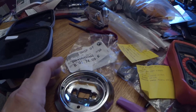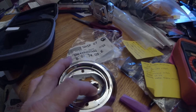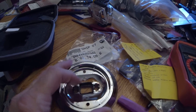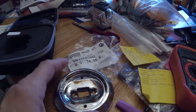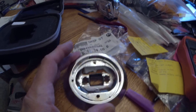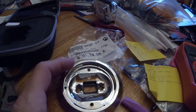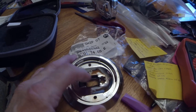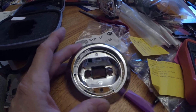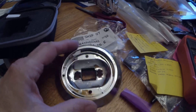On the factory one, around where the electrical contacts go, there's a blue plastic insert. The reason is the vacuum-deposited chrome — like you see on this one — is conductive. So as soon as I put the contacts through here, there's going to be a direct short and it's going to be popping the fuse for the overhead lights and the accessories in the car.